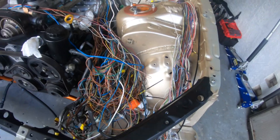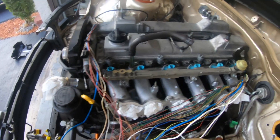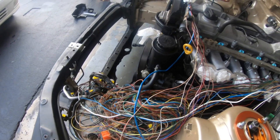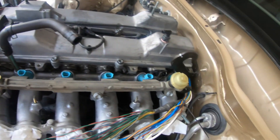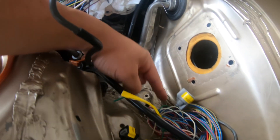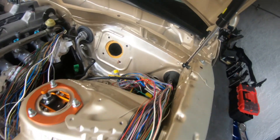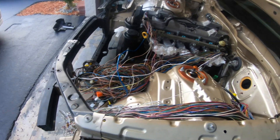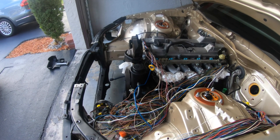On the next video I'll be dealing with these plugs. The main goal is one by one, each plug — put it in position so I know the lengths. All this wiring, little by little, is going to start routing from the original area where it runs down the throttle body, across the motor, looping in here — either this way or behind the AC line — and then the end goal is to run everything through the existing grommet that used to be here. I also separated the wiring on the driver's side from the ones that run to the front of the car, and I'll worry about that later.